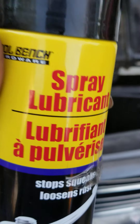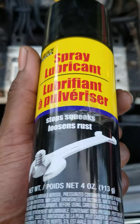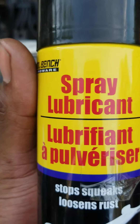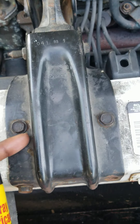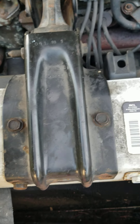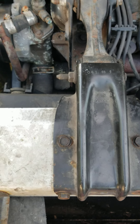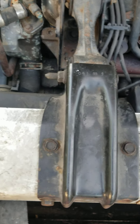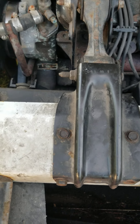This is basically a wrenching spray can. I don't know if you guys are familiar with it, but it works great when bolts or screws look like they're rusted to the body. You just spray it on there — not drench it, just get it wet enough to sit for a couple minutes. Then you put your wrench on there and it busts right off.